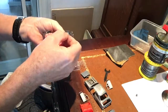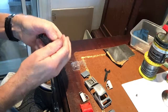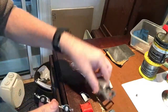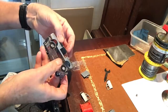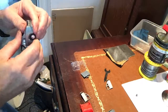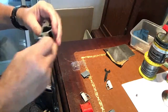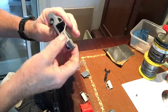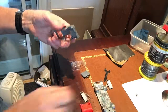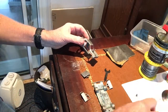You can see in the background there's some 600 wet-and-dry paper which I've given the whole body a rub-down with, then gone up to 1000 and polished it smooth. That's usually enough to accept paint — with a good rubbing with wet-and-dry all over, you don't really need acetone or any other chemicals to help the paint stick. That's what the primer's for, and as you'll see it does a pretty good job.